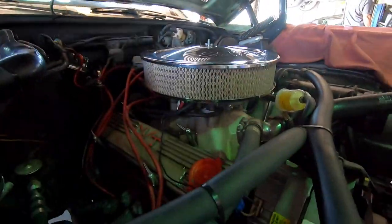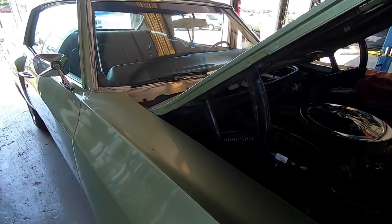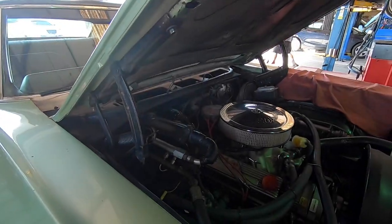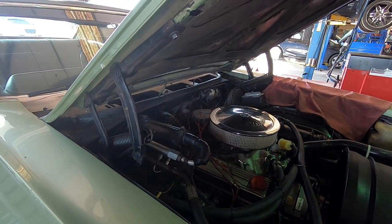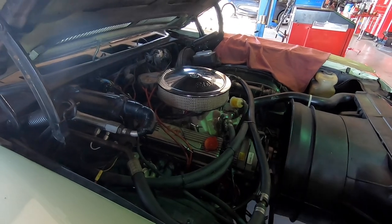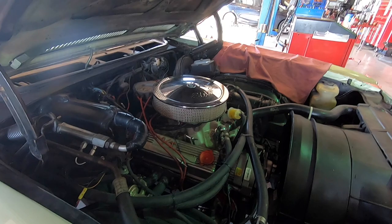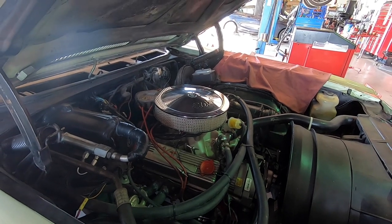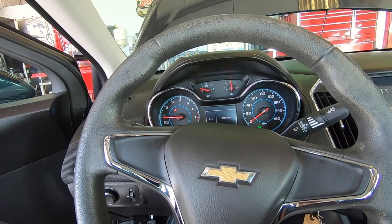Monte Carlo carburetor's on there, running good. They came in for a leaking carburetor but I put a new one on it — it was leaking in a couple of spots. Weird thing is the choke wasn't wired right. It was wired to the field wire on the alternator rather than the ignition feed on the alternator, so the choke didn't work. Got all that working. Runs like a charm now. Chevy Cruze, 74,000 miles — about the life expectancy for these things.